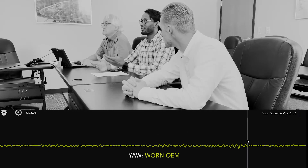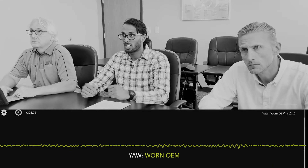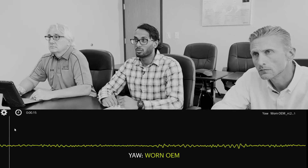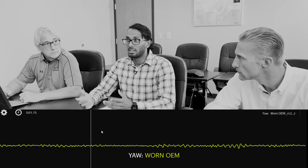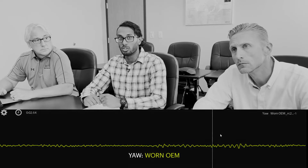This could indicate that either the shocks are really worn out and they're just not having good stability on the road, so there's a lot of bouncing happening causing it to deflect left to right rather than brake in a straight line. It could also be an indicator of driver confidence — if those struts aren't performing well, the driver's feeling a lot of shake in the steering wheel and they're not able to get a solid braking maneuver.